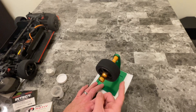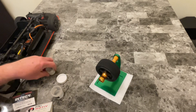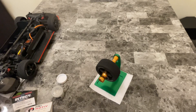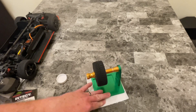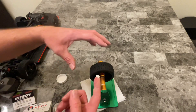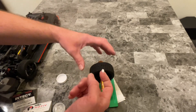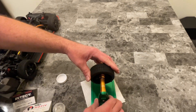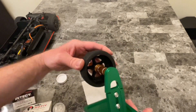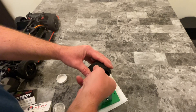We're going to slow it down just a little bit and let it spin. We'll see if it comes to a dead stop. We're rolling just a little — we're really close. I'm going to add just a little bit more clay right at that dead center spot. Got a little bit of clay — this sticks very well. Put it right up top, dead center. Looking inside the wheel, it's right on top of where I originally put my first bit of clay, so I'm going to press that in a little bit.